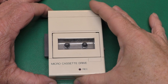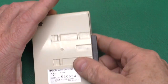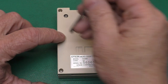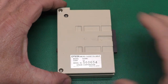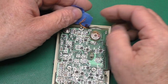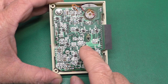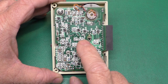You might remember we can just release this micro cassette drive from the main computer and slide it right out - it plugs right in. If we flip it over there are two screws here that hold this back cover on. I needed to go ahead and take this apart so I can measure the belt. No, it does not come with blue painter's tape - I put that on there to protect some wiring which I had to desolder. Here we have our circuit board for this cassette unit, and you'll notice that these are all surface mount parts. From today's perspective these look like large surface mount parts, but back in the day this was quite an advanced circuit board.